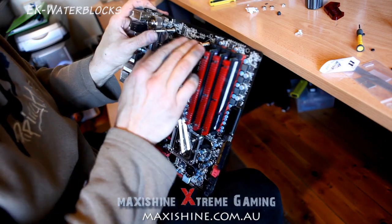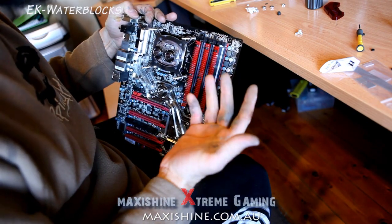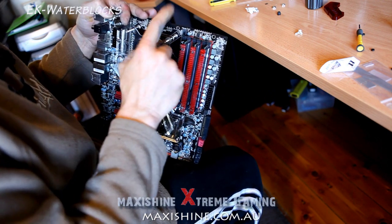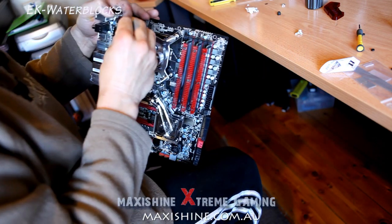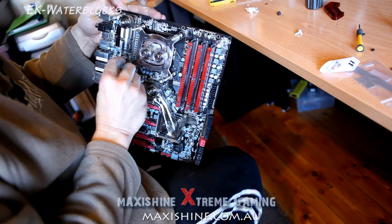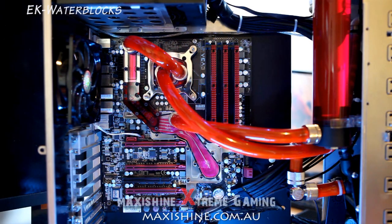So this is where we're at. We've put the bolt on the bracket and we're pushing down the EK Supreme water block. There are a lot of fingerprints but not much I can do about that. Put on all the little thumb screws before tightening anything and give it an even distribution of tightness. Now we're just bleeding out the bubbles, letting the system run and looking for any leaks. I've had leaks before, so you need to sort that out quickly. To power just the pump, short the green and black wire on the 24-pin or 20-pin motherboard plug.